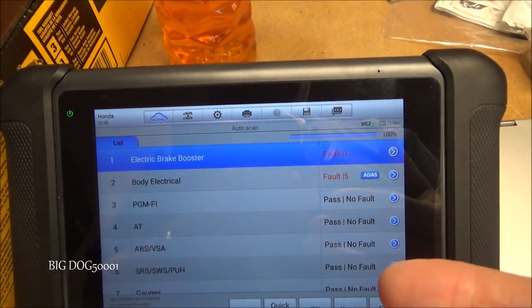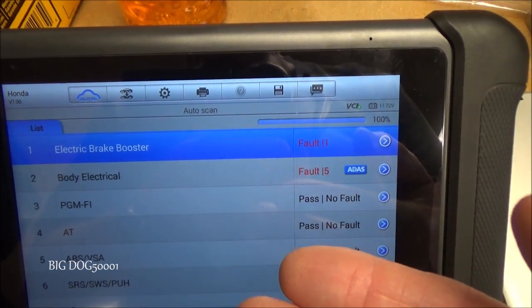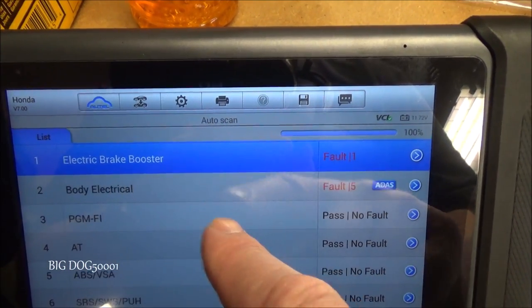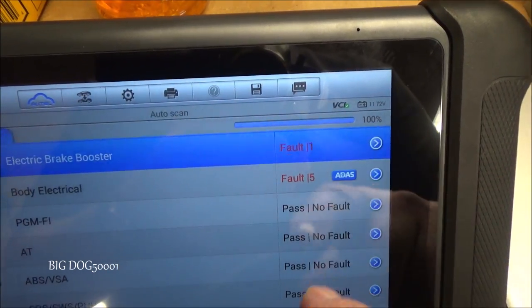All right, a little bit of bonus footage. Another way to confirm our suspicions of what's going on with the brake booster is to scan the car. So you can see I scanned it, and there's our electric brake booster control module right there, and we do have a fault. So we'll go in there and check it,